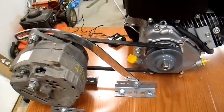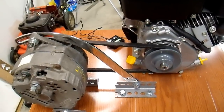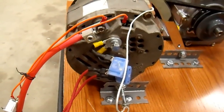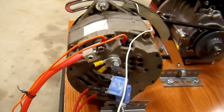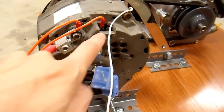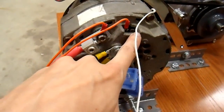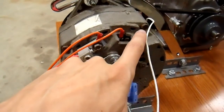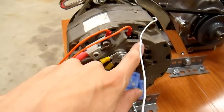Alternators like this in their typical configuration are only around 50 percent efficient, but if you do this sort of thing they get quite a bit more efficient — 65 percent or so, peaking around 70. Alternator efficiency curves are rather hard to find on the internet, but they do exist. Anyway, I just wanted to explain that because I don't think I adequately explained it before. Now I'm going to continue to hook this up. The alternator is all hooked up and I'm ready to do my initial test of my belt-drive 12-volt generator. Terminal 2 is the reference — this time I did not get them mixed up.